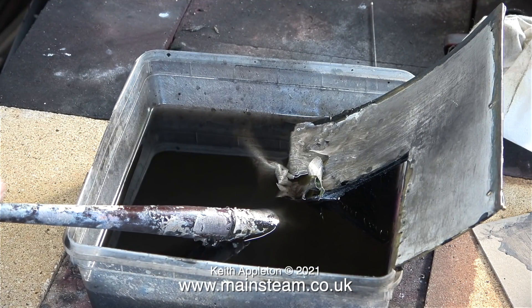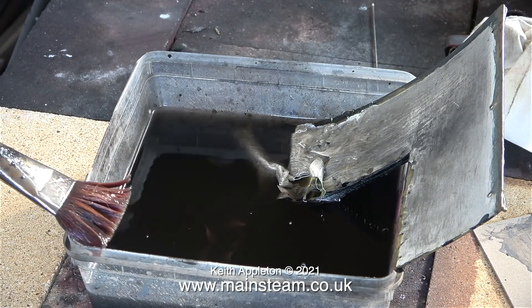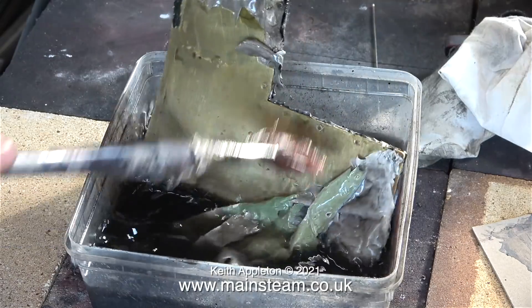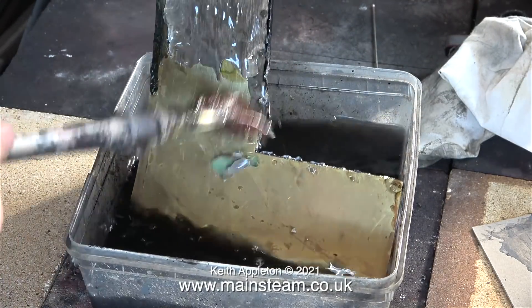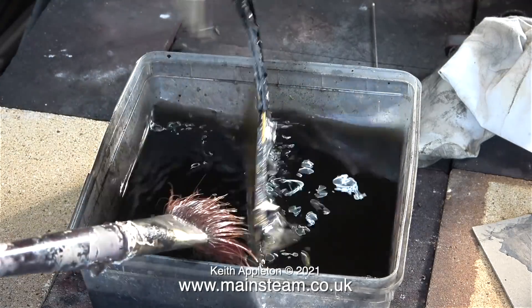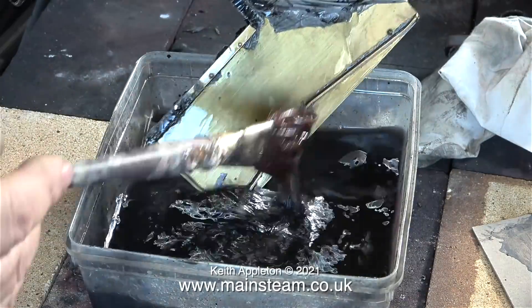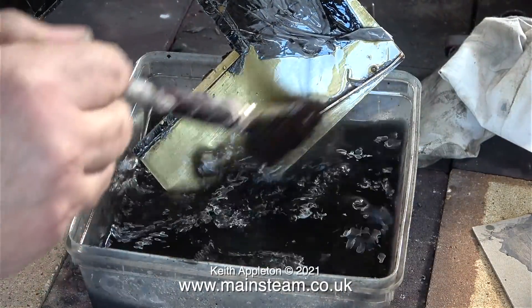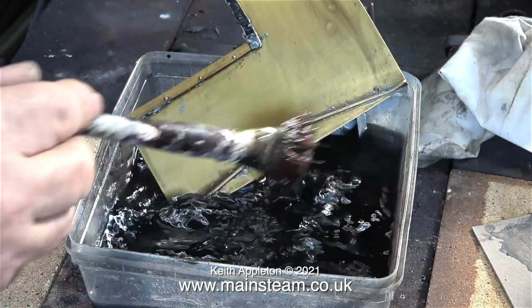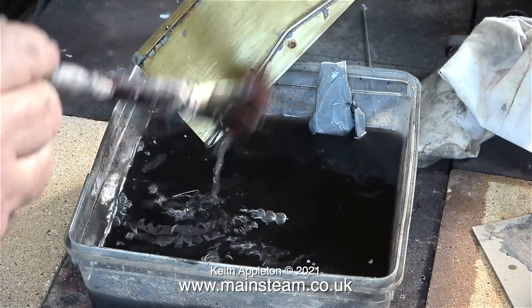In the last episode I could only fit half of the roof in my tub of cellulose thinners. 24 hours later and the paint has more or less fallen off. I left an old paintbrush in the cellulose thinners and the bristles didn't like it much. This is just as I found the roof after 24 hours in the bath of cellulose thinners - the paint just drops off the metal. Even on the underside a sheet of paint is coming off an area that wasn't actually submerged. I must caution users of cellulose thinners - this is not nice stuff to use, it really smells bad. Most of the time when you see me using it I'm by a wide open door. You must never use this if your area isn't well ventilated. I like using it for this job though - it's very non-invasive, it just gently tells the paint to go away. It's not good to touch it with your fingers because apparently it soaks in through your skin.